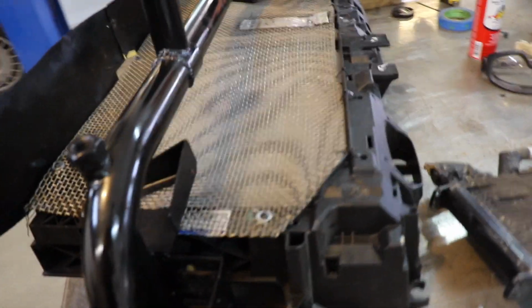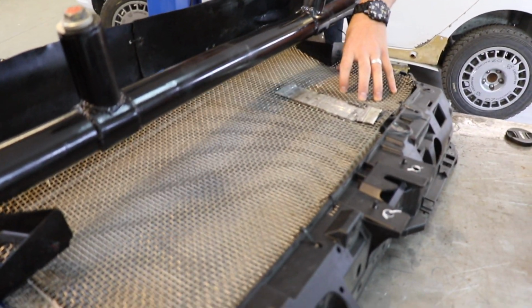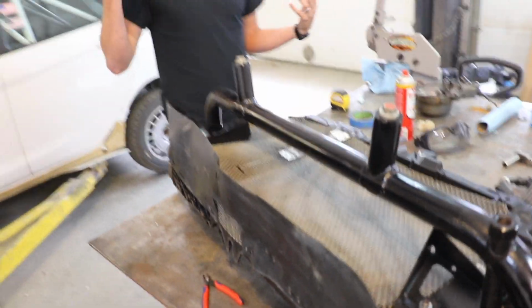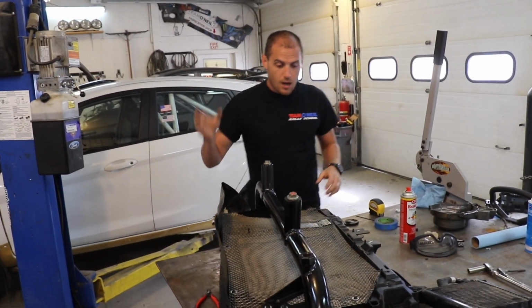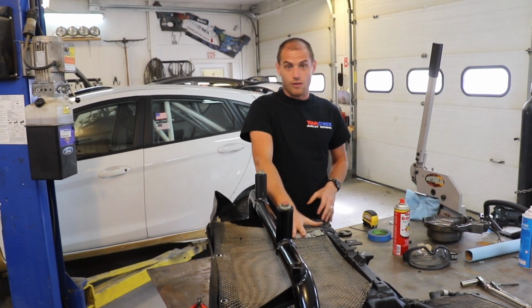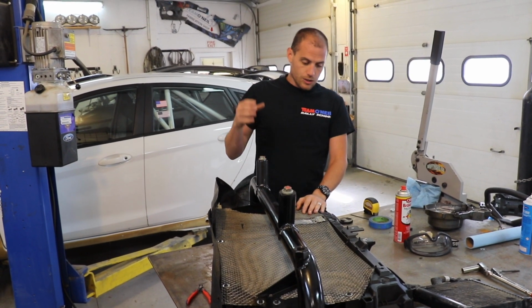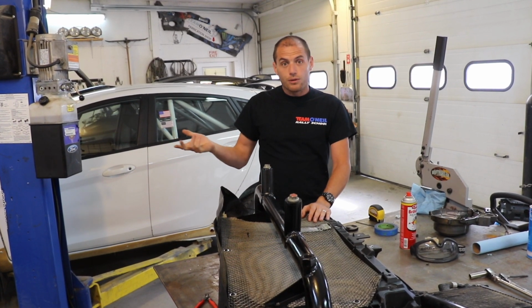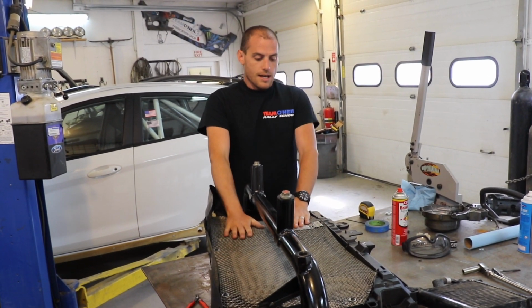And this is something that's actually quite important to do for a rally specific purpose, or potentially off-road or desert racing or anything like that. Again, it's just the amount of debris that you're driving through, whether you're catching another car and he's kicking up rocks and dust and sticks and who knows what in front of you, and all of that stuff's going to be hitting your radiator. That's a bad thing. You'll get the radiator clogged and your car might overheat. You'll get some kind of a projectile that goes through the radiator, leak all your fluid out, and you overheat and blow your motor. So for a bunch of different reasons, it doesn't hurt your airflow much at all.